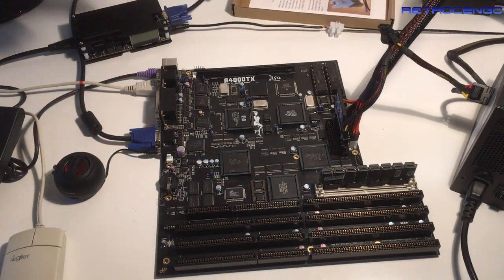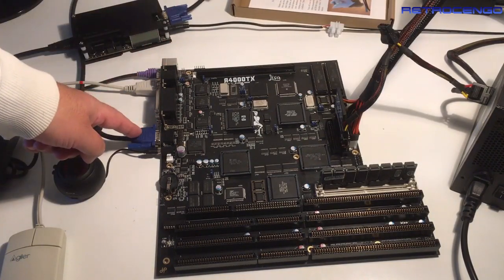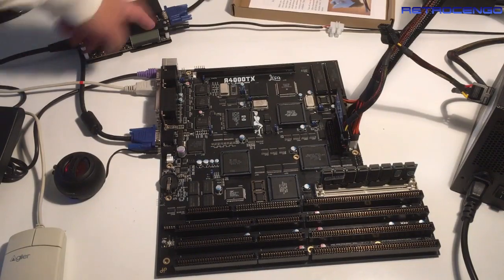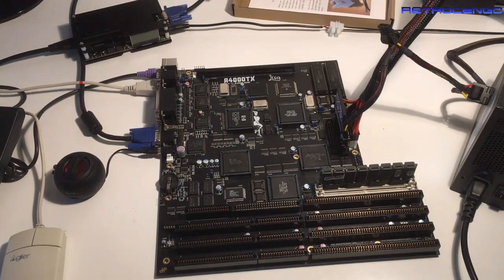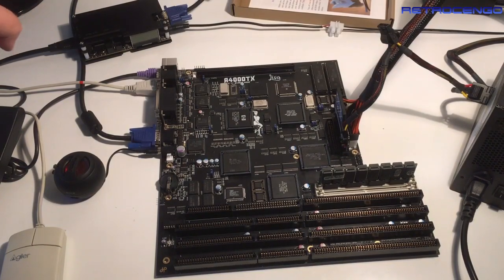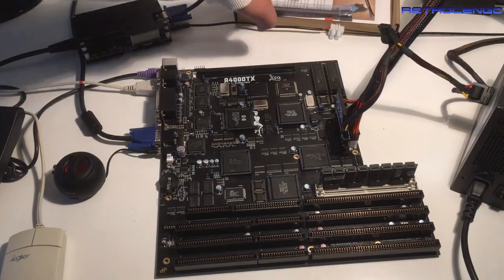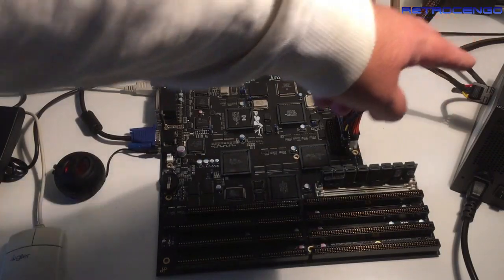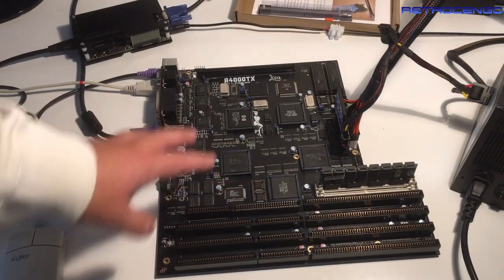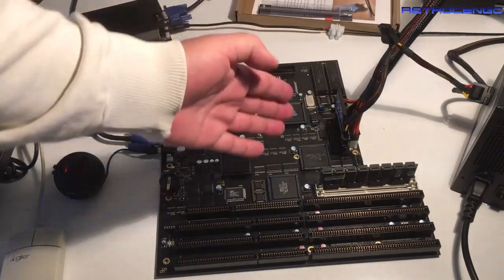I have connected PC keyboard, Amiga mouse, VGA out to OSCC, gave it 5V power from OSCC, digital video out, HDMI to the Samsung S24D300 monitor. That's also a donation to this channel. I didn't mess with the Kickstarts. It's just a built-in 3.0. Corsair CX 430 watts PSU. We have power enough, compact flash card, 8 GB. I don't know what's inside.